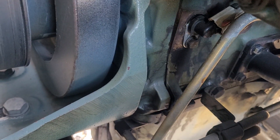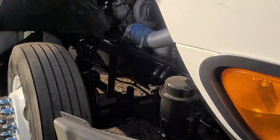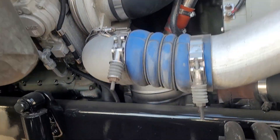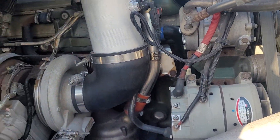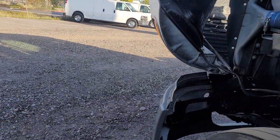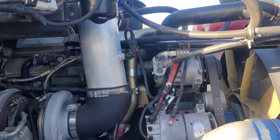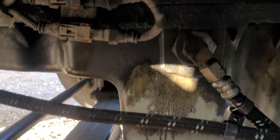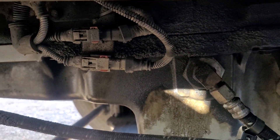Up on top it's dry, so it looks like it is an oil pan gasket. Back on the first truck on the passenger side to verify – there's a piece of plastic randomly in there, but no oil. There's some grease but no oil on the oil pan or passenger side of the block. Back to the second truck – the gasket is just seeping but it's not dripping.